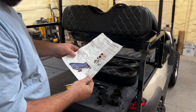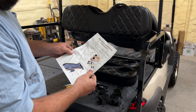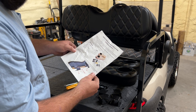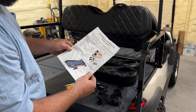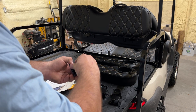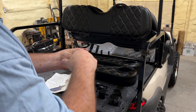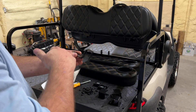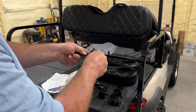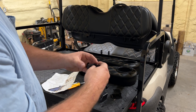Now it looks like that's all here. The first thing to do per the instructions is open the flip hinge to 90 degrees. Because it's a dampening hinge it will be very tight, so please be careful when opening it. Then use the 6 millimeter by 18 millimeter cross countersunk bolts to fix the hinge on the armrest as the picture shows. And it's right — it's very tough to open. It takes a little bit of pressure to pull it apart. So it talks about pulling them all apart like that at 90 degrees, and that's what we're going to do.